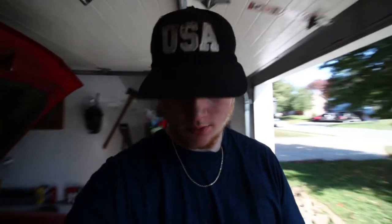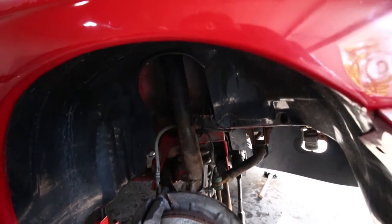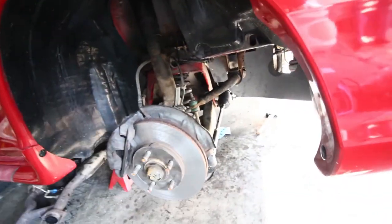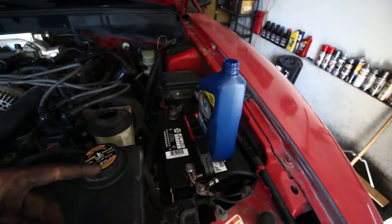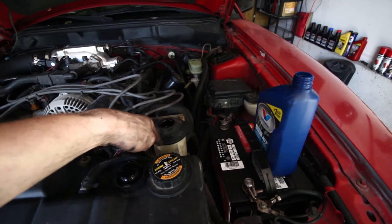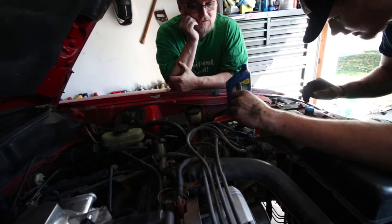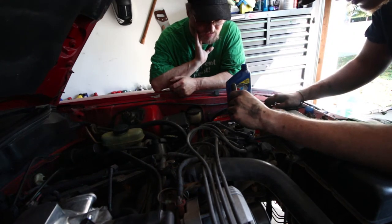All right guys, another progress checkpoint here. I got pretty much all the suspension stuff back together. Here is the brakes and suspension — everything is back together. We are about to bleed the power steering system because I did replace the power steering rack. I've got some Mercon 5 ATF up here. I've been reading and I think that's what you're supposed to use. So I'm going to fill this up, let my dad watch it while I turn the steering wheel, and we're going to bleed the power steering system. Just need to watch — I'm going to turn the wheel and it's probably going to go down a little bit, so just make sure it doesn't run out.